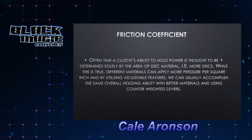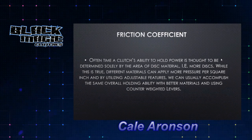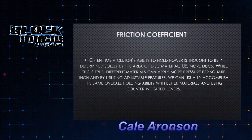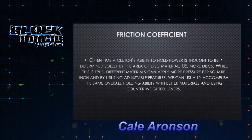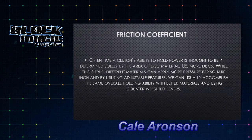Basically, what that means is the lever geometry and the weights and things like that are not really optimal to where they need to be. So that's why we redesign that and work with our fulcrum points, pivot points. We change the ramp rate so that we can control how fast or slow or how much counterweight you're using. And the reason for that is you don't want to be down on a car like that turning